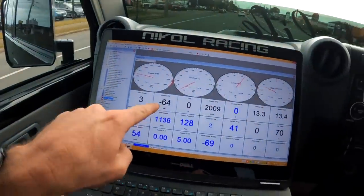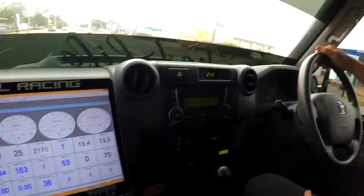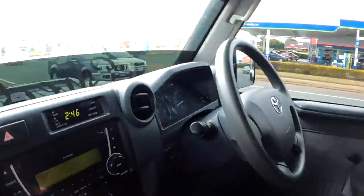Oh, this sounds aggressive — okay, that's sports auto. Let's see how it downshifts — much more engine braking. What do we get on the torque reading? Minus 60 newton metres, where earlier in normal mode the most I saw was about minus 40. This would probably be good if you were towing up and down hills where you'd want more engine braking — take the load off the braking system. The transmission is up to 71 degrees now.